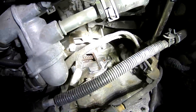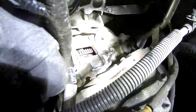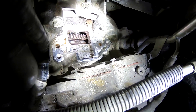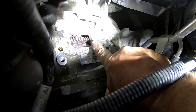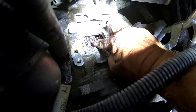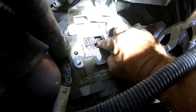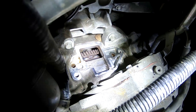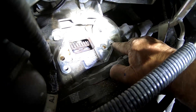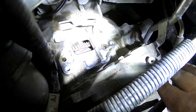I wanted to do a quick video of what it looks like inside where the starter mounts before putting the starter back in. You can see the teeth — that's your flywheel, where the gears from the starter will engage. They look fairly clean with a little angle on them, which could be from the starter engaging over the years, but the angle is pretty consistent on all of them so that may be by design. That flywheel looks good. You can see where the bolts for the starter go — one here and one here — and there's an alignment pin here.